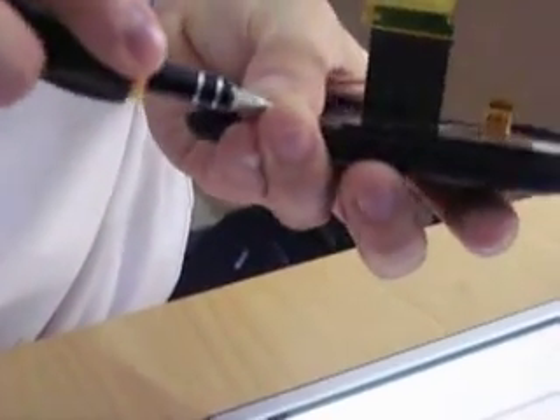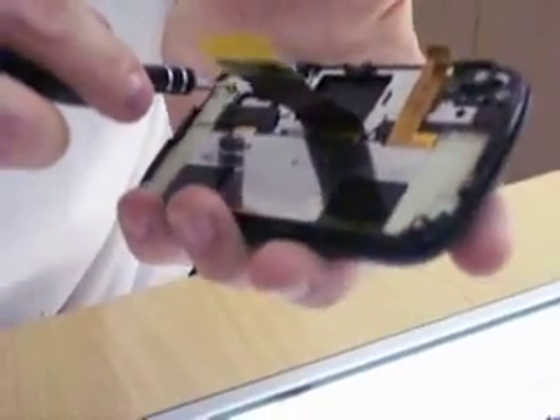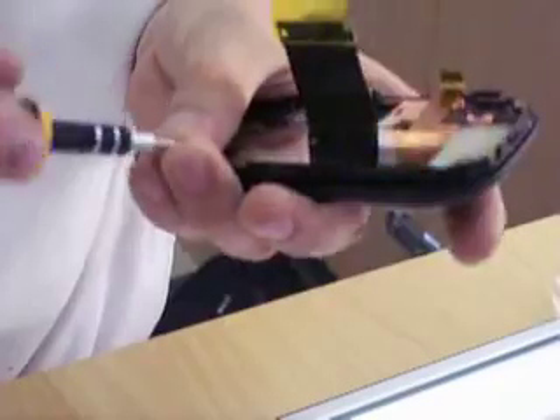Now take this part of our phone — the keypad — take it underneath here, slide that metal lip right there, and slide it up. We have six silver flat short screws that have Phillips heads on them. I'm going to go ahead and put a couple in just to hold it in place to keep the video moving. Make sure you go ahead and put all of them in. If you don't, it will work for a short period and then it will come apart, and you don't want to be that guy.